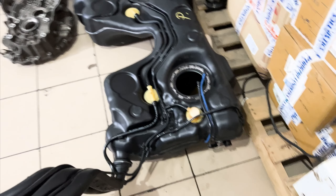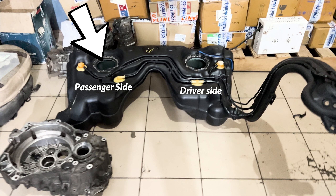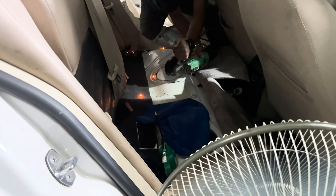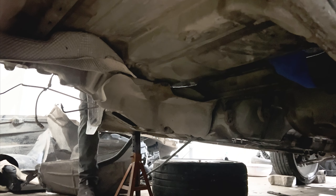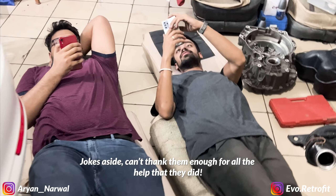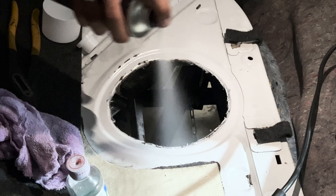The new fuel tank has two halves and two openings. One holds the fuel pump and the other holds the secondary fuel level sender. It also has a location where the Haldex connector will come out of, so our car needs an opening there. The hole is just blocked off and the template is quite clear, so a new hole can be cut easily. We made several holes along the perimeter and then took a grinder to finish the job. It took quite some time to give this hole some finishing.